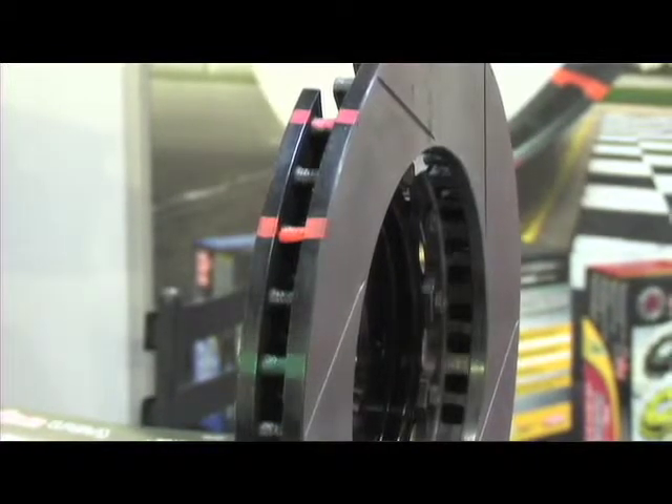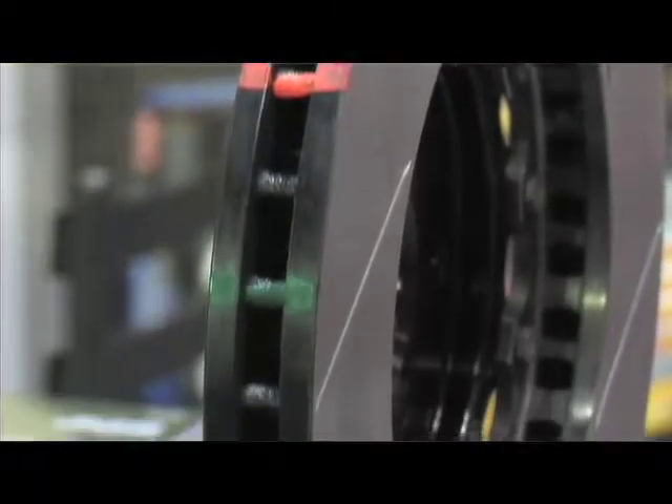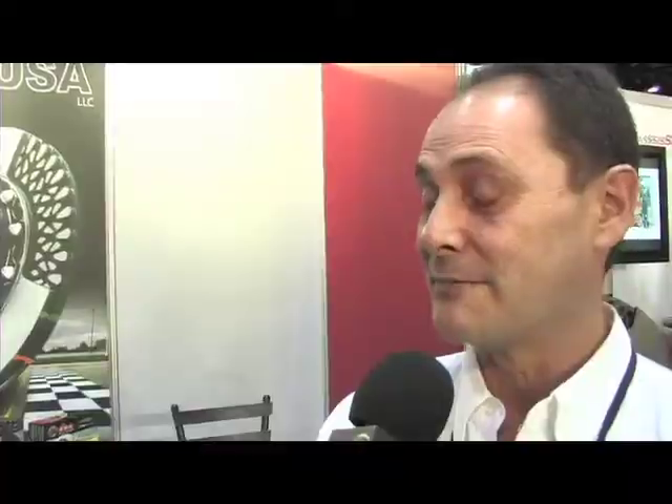I see there's some paint on the outside of the rotors. What is that for? That's another unique feature that we've put on our racing and performance rotors. It's a heat-changing temperature paint. It's to help the enthusiasts and the racer monitor what their braking system is doing. As the rotor reaches certain temperature thresholds, the paint starts to change color. If they've got the paint starting to change at the red level, they've got a serious braking issue — those discs are nearly melting.